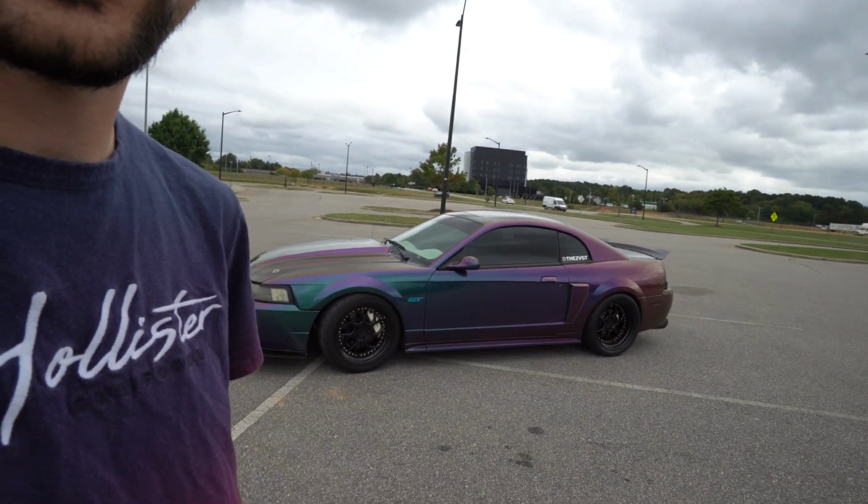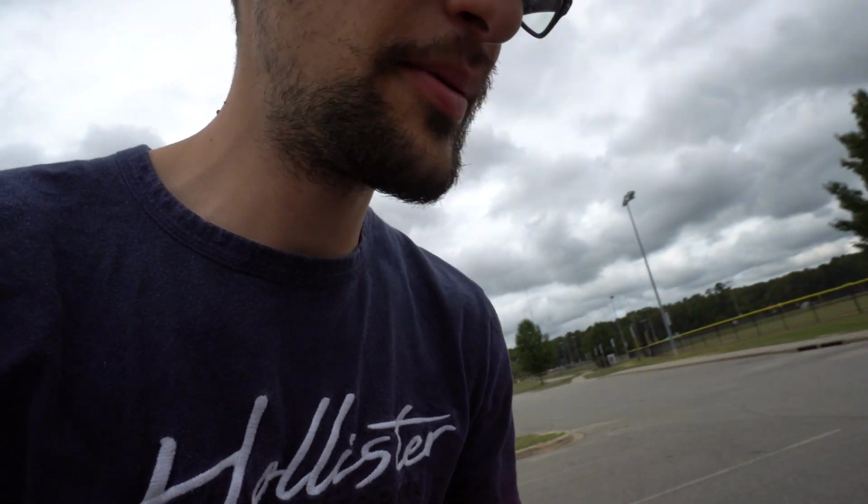It looks like I have the drag tires in the front because I ordered the wrong size for the Firestones. They are 275/40 18 and they're supposed to be 275/35 18. So I'm going with a different tire soon. I have so much camber, the inside of the tire is already ran off anyway, but psst, nobody gets to know. Good.